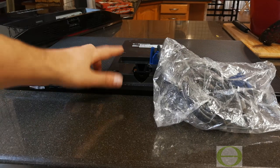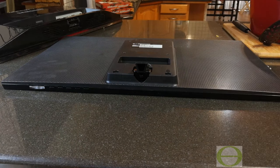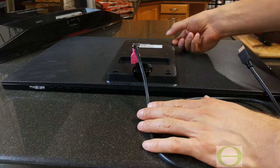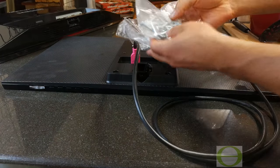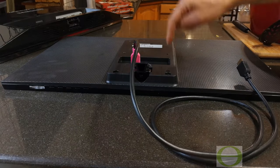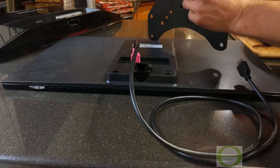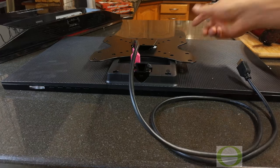If you're going to install this monitor on a wall, you'll have to rethink the whole story. If you're using HDMI, you'll need an elbow connector, or you'll need a bracket with very long spacers. A washer isn't going to cut it — you'll literally need 20mm spacers and extra-long screws, or you'll have to use big 10mm nuts to create enough clearance.